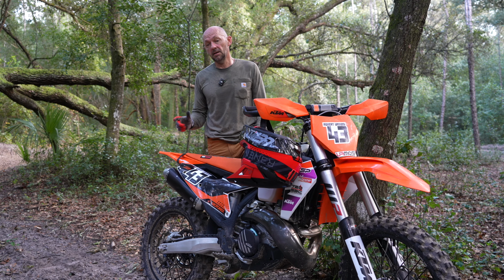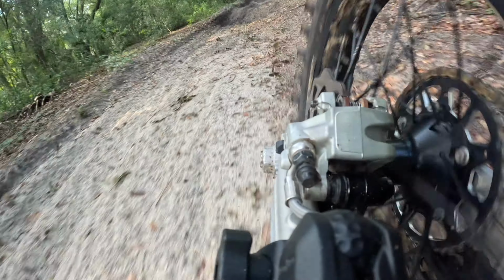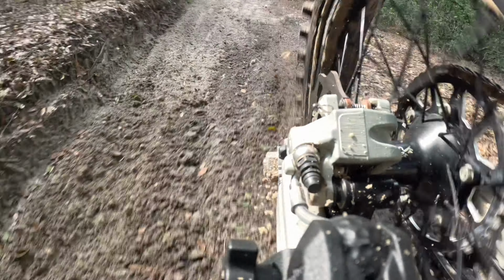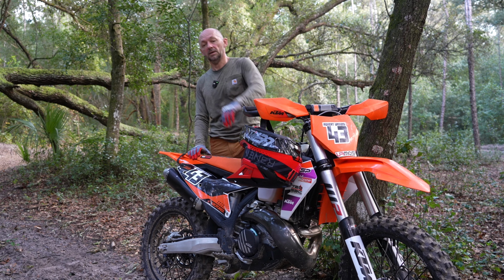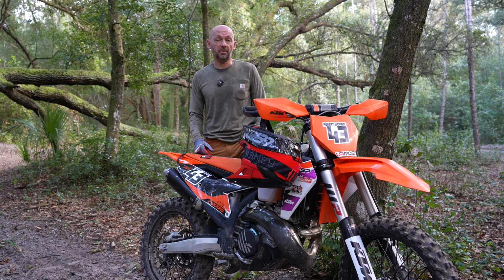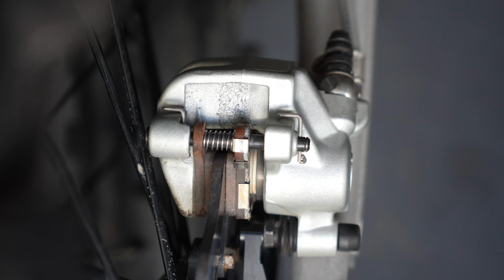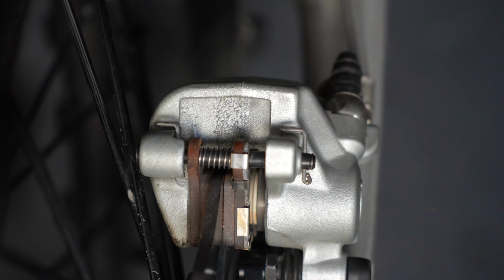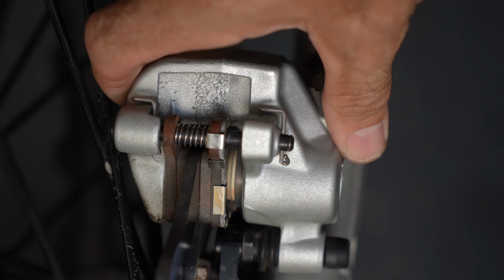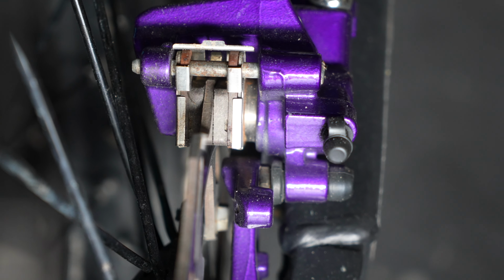So with the spring, the brake pads can be about a millimeter away from the rotor, which is a good thing. Now we've achieved something that creates less friction. But the downside: I got a huge amount of comments on my social media post. Some of them were quite educated, and they said dirt can get in and ruin my brake pads. If the gap was huge, then you'd probably be right. The gap is small, but it still can happen.